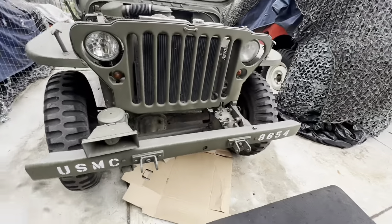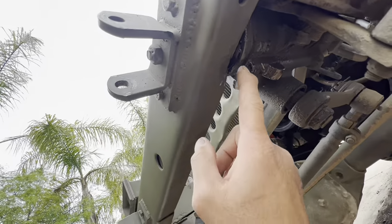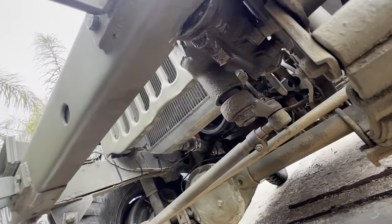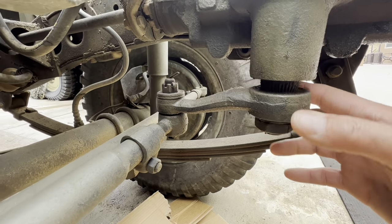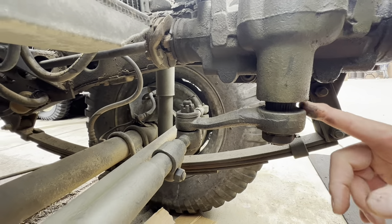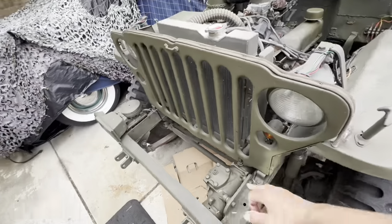Alright, we got slum dogs next up on the list. We got to change out that steering box to get my power steering going. It continues to weep from here even after all these months, it's still going. We got a bolt here and then two more on top, then we got to come down here — unbolt this, take this off. Hopefully it comes right off; it's obviously lubricated so it should come right off, fingers crossed.